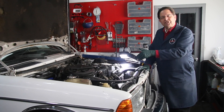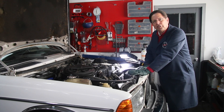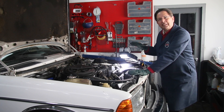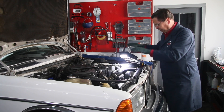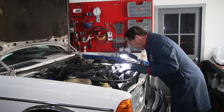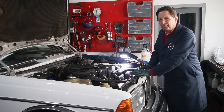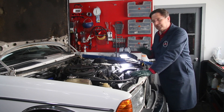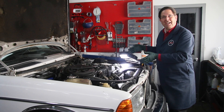When you're checking or setting injection pump timing, particularly on these 617 turbo diesel engines, you need a really, really good light. It's hard enough to try to hold a flashlight and look down there, but if you have a stable light that you can shine down around the front of the engine to clearly see the marks on the counterbalance and the pointer, you're way ahead. If you don't have good lighting, you're going to have a lot of frustration setting the IP timing. This is where my super light really shines.